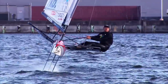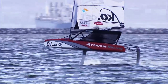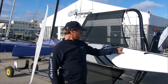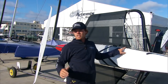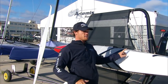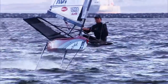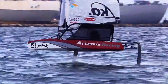The moth has a very simple system. We have a wand at the front, and as the wand moves, it changes how much lift you're getting — it's very active. This flap just touches the water. When you're in the water, the wand starts down, flap down. As the boat accelerates, the flap down gives you lift and it flies. Instantly, the wand starts to come forward and it stabilises you. Eventually, the wand sits in a comfortable position, the flap sits in a balanced position, and you rip along.